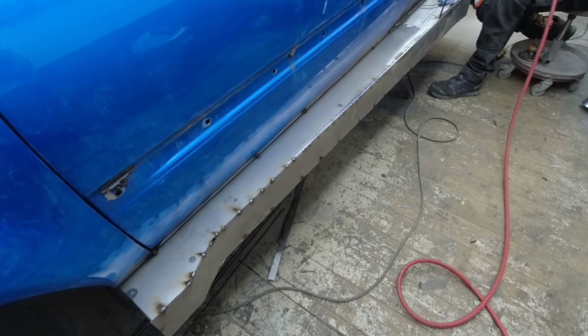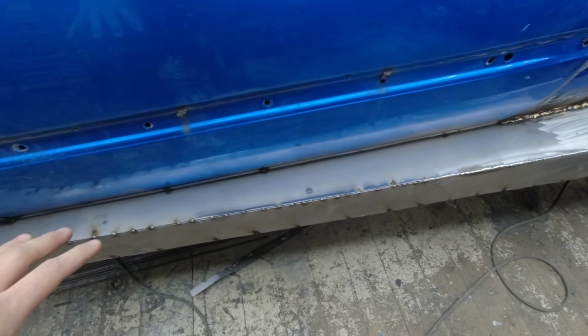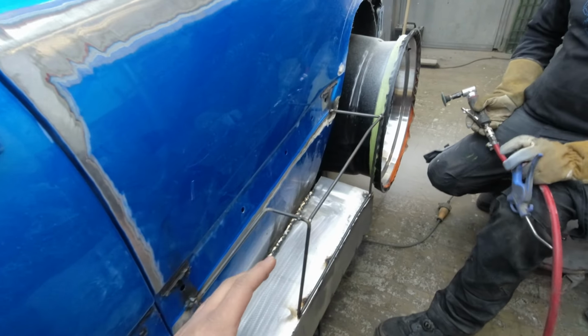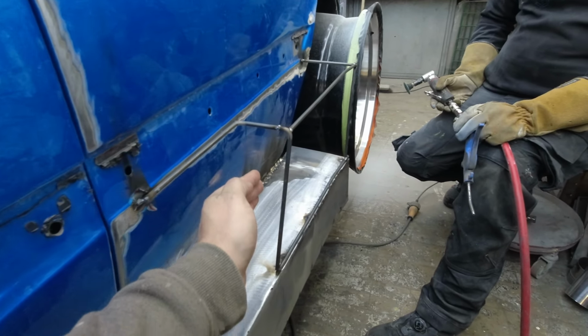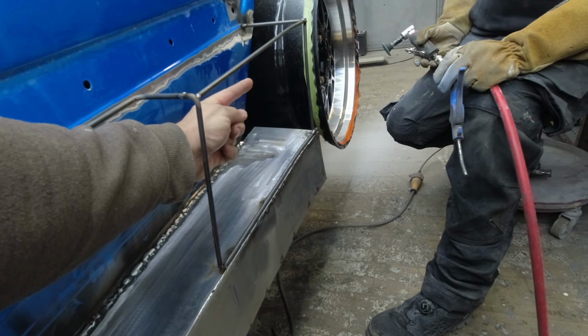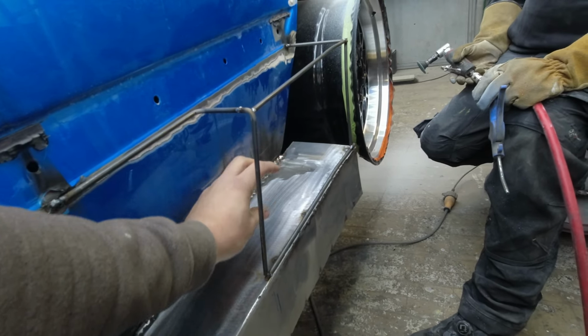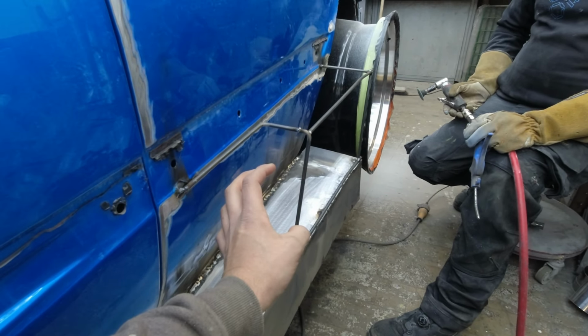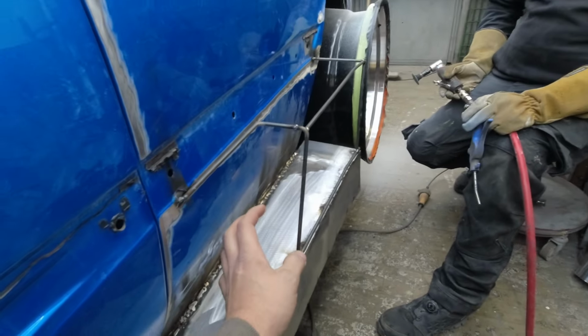Okay guys, my voice is soon gone, but we're coming way further than I thought. I think the clock is like 1 or 2, middle of the night. The boxing on the left side is actually done. I've shown you a little bit in the videos how we've done it, but now we've spot welded it, and we fully welded this part and this part, because now we're moving further with the box. This is going to be an air inlet, and we're going to have a tube that goes into the box and around the wheel and onto the backside of the wheel to the brakes. So we're actually going to have active airflow for the brakes. And yes, maybe overkill, but I've always wanted to do it, and Martin always loves my dumb ideas, I guess.